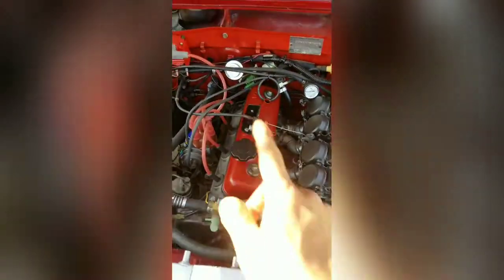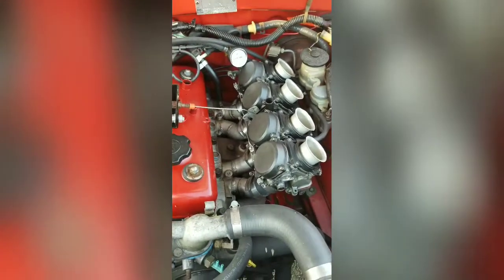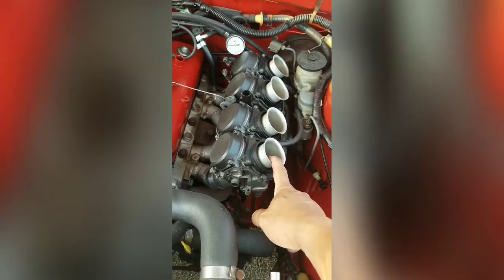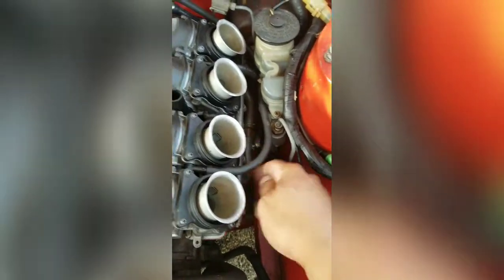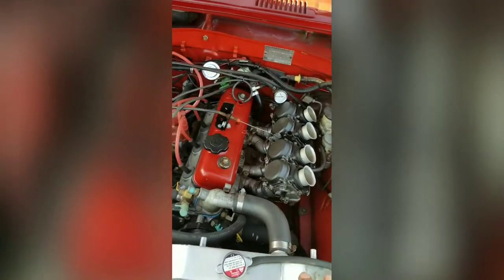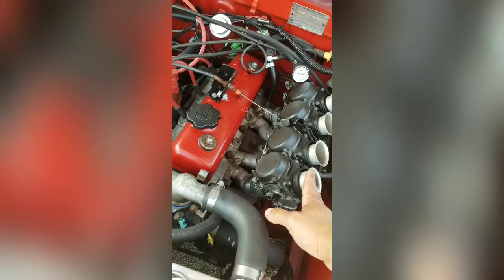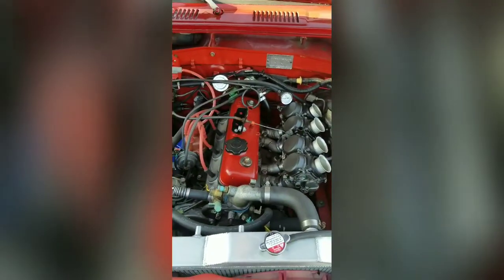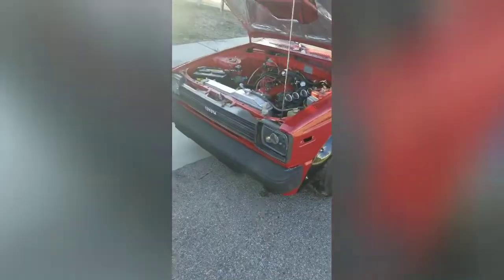I've got too many projects. The Starlet KP61 has the stock 4KC engine — a 1.3 liter. The carburetors, as you can see, are actually motorcycle carbs from a 1996 900R bike. They work great, but the second you stop using it, it starts leaking from every seal — the o-rings, the float — if you don't drive these things often, the carbs go to crap. I've rebuilt it every time I don't use it for more than a month, and quite frankly I'm done with it. It runs great and you get more power, but the hassle is not worth it since I don't daily this thing.